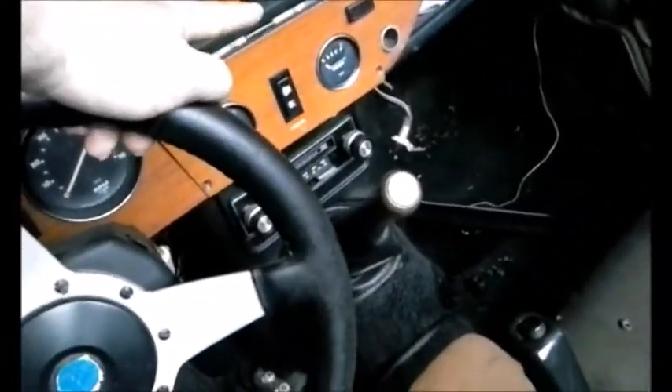I'm going to go ahead and get the cooling system topped up. It doesn't hurt anything to let it run for a few seconds without coolant, but you don't want to let it run much more than that — you don't want to let it sit here and run for five minutes with no cooling.